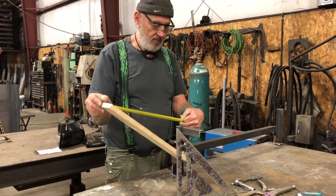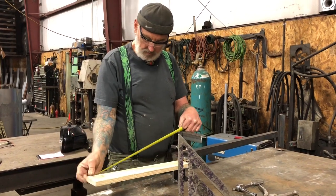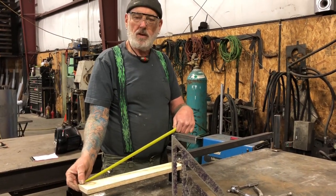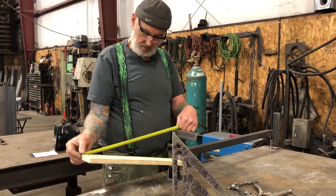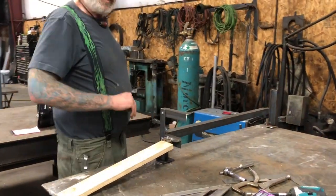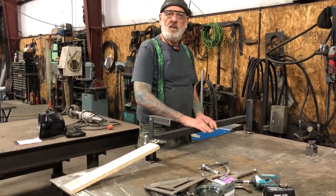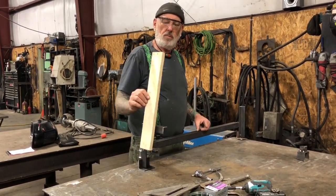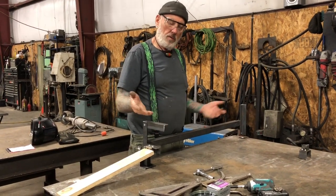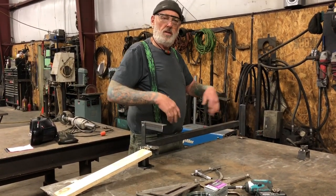When we get where we're going, depending on what's advantageous, one side could stay down and the other side can tilt up to 45 degrees and be held there. There'll be some notches in the middle so sometimes it might be best to have it level. I'm going to go with rooftop, flat level, and 45 degrees. This goes 16 feet down the bus — these all continue on, and then this walkway means we're going to be able to wash our solar panels, clean behind them, or work on the wiring. This is also a handrail or roof rack so we can put cargo in here — it's a roof rack cargo holder, walkway, and solar panel system.